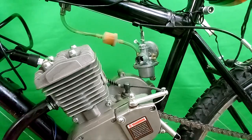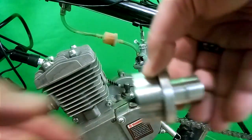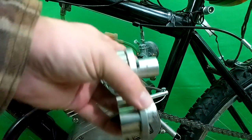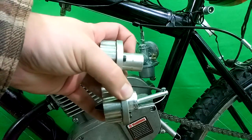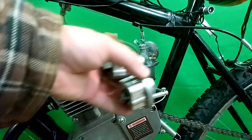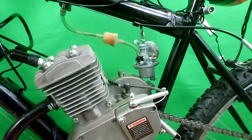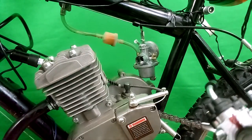So get this reed valve off of this carburetor. Here's what it looked like when we started — this is the one with the broken valve in it. Here's what it looks like now. Basically, everything from this little notch forward is cut off. I had sanded it all down, ground it all down so it fit. But the problem was it was so long that there was no way I could put the carburetor between here and the frame. So I had to cut it down to this, and I still had to grind it down because it was still too large a diameter to fit. And the thing is stretched — that big gap in there is not supposed to be that big. I put some grease in there to try to make sure it wasn't going to cause a problem. So this isn't going to work.